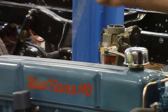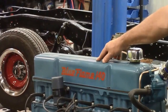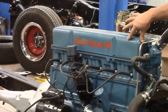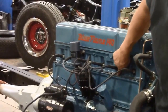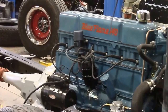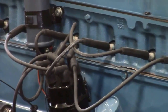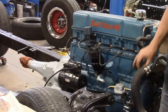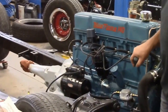Along the sides here you'll notice we've got a reproduction Blue Flame 140 decal, which is the correct reproduction decal for it. We've got upgraded high temp wires and coil. You'll see that when we reassembled the engine, we painted everything separately — so you'll notice that all the cork gaskets and the copper head gasket and side cover gaskets have no overspray or paint on any of those components. The camera can probably pick up the cork along the sides. We've also replaced the vacuum advance, which wasn't working on the original engine, and we've replaced the fuel pump — once again with nice fittings and copper line.